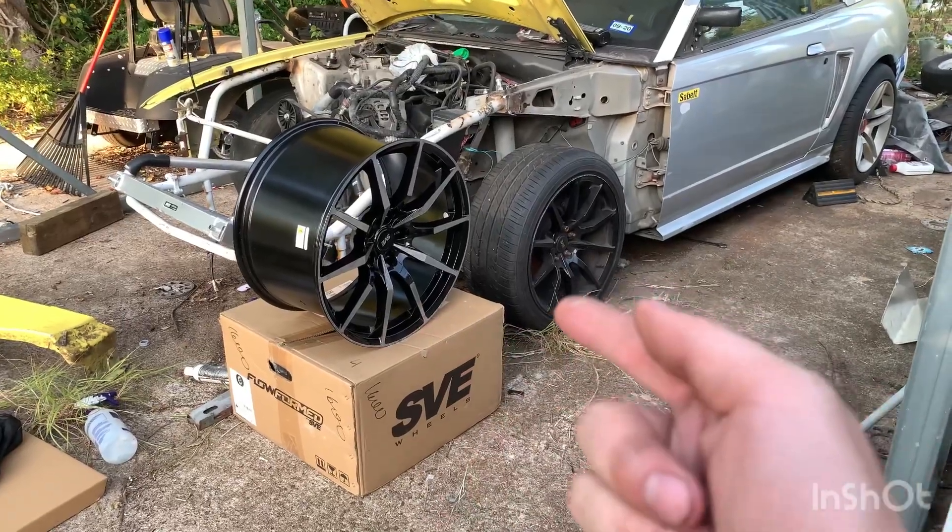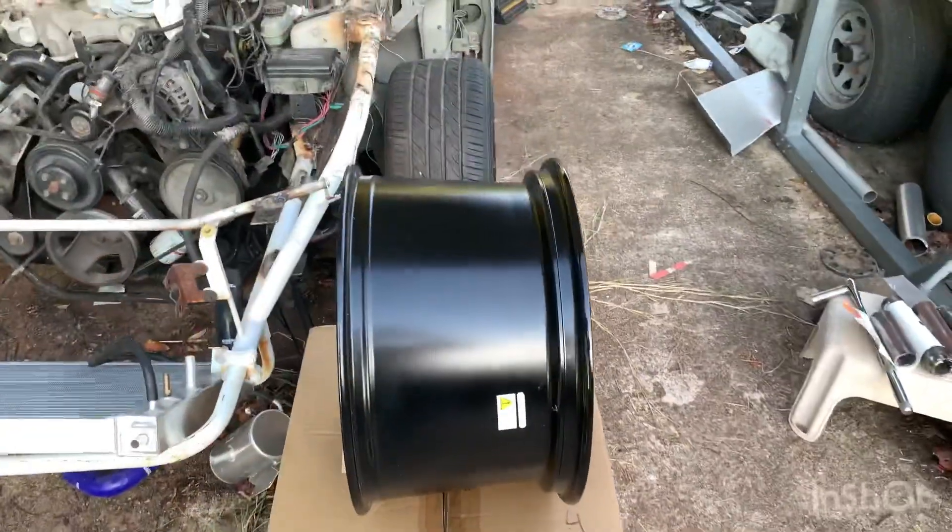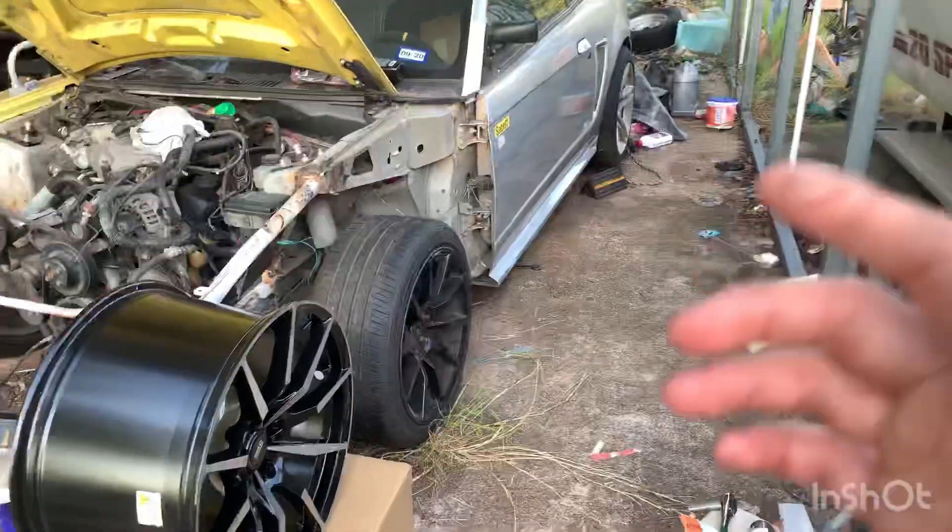These are the new 19x11s next to the 18x9s — the front end is going to be an entire four inches wider up front, with 18x10s in the back. I actually want to buy forged wheels to go with my wide body kit, but I'm working with what I got for now. I want to put 325s on the 19x11s and 275s in the back. Those are the first forged wheels I'm going to get, and then I'll buy more forged wheels for the front. The entire car is going to be eight inches wider front and back, but right now it's two and three-quarters inches wider in the back and four inches wider up front.